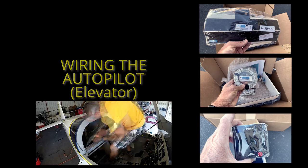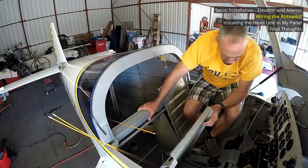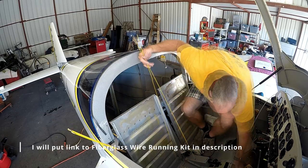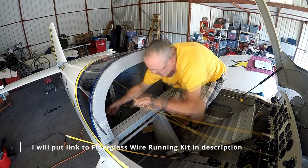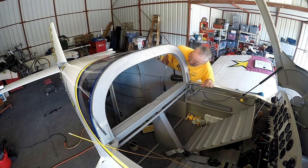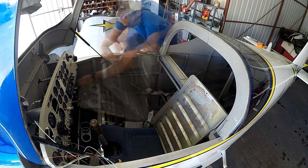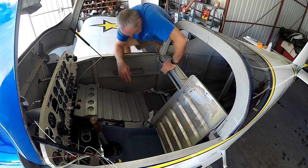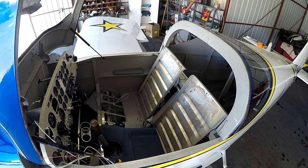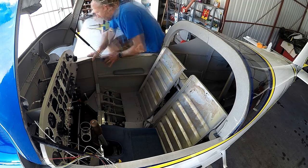Now we have to route each of the servo wires into the cabin. From the elevator we need to come up through the fuselage, under the seating area, and up into the dash. This involved removing some interior panels and figuring out how to securely route the wire. I used fiberglass fish rods — the kind used to run speaker wire under carpet — feeding them through the holes along the longeron and attaching the wire at the back of the plane, then pulling it through to the front without having to crawl through the fuselage. I then drilled an access hole under the floorboard to get the wire beneath the carpet and seating area up into the dash. Make sure to stay clear of all controls so the wire won't get caught in any moving parts — check then double-check your wire routing and the control movements.